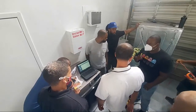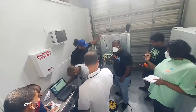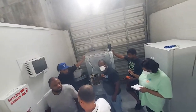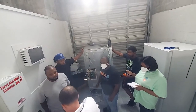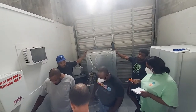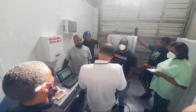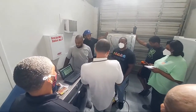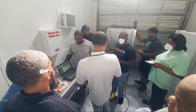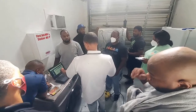Can I ask you a question? Sure. Okay. Well, when I was over here looking for that CN75, none of this ain't really looking right. Because Samsung, look at the way they give it to you. They may give you model RF26B2, so you getting very close, but it may be a little bit off. So in that type of situation, you're better off looking at the color of the wire? Yeah, and the connector location. Okay, so CN70 red.